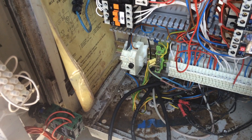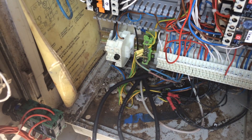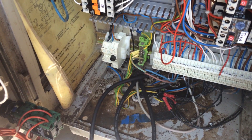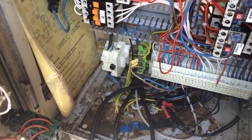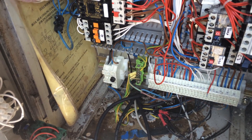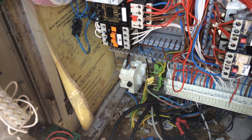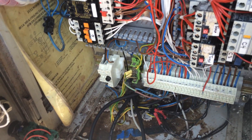I came out here, it had blown the fuse, mega'd it, couldn't find anything wrong with it, put a new fuse in, and it blew straight away. Mega'd it all again, couldn't find anything wrong, put another fuse in and it worked fine. Then the next day it blew the fuse in the wash, and today it's just run through the whole wash with no problems at all — but it always blows in the same part of the wash.